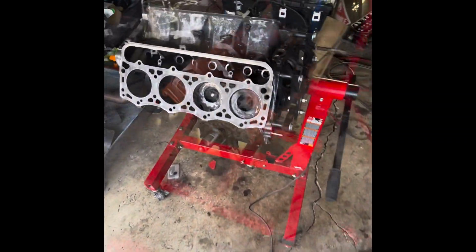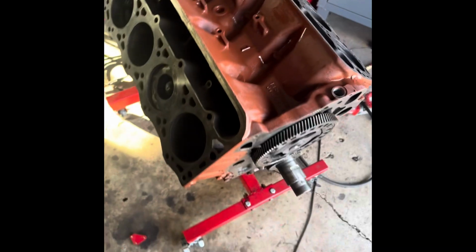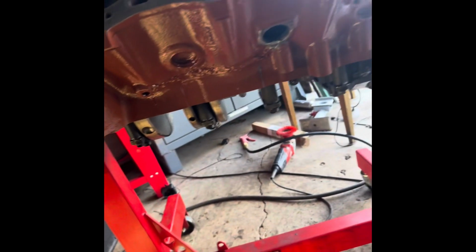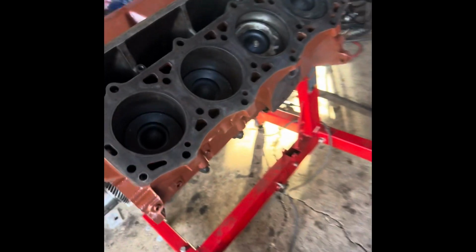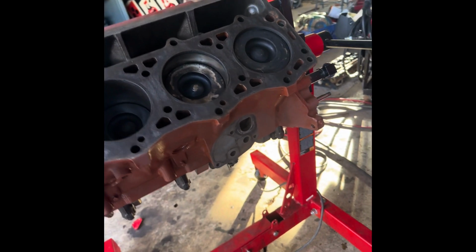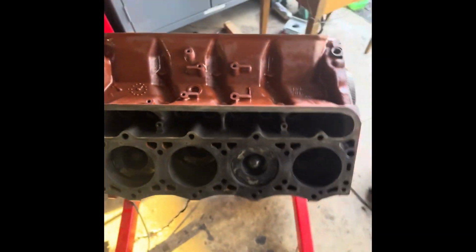So here comes the paint. All right. Turned out freaking awesome. So yeah, primer coat on. And then I got a little repair I got to do with some nickel 99 rods in a freeze plug hole from the weld. Found a blemish, so I'm gonna fix that up. And then hopefully tomorrow we'll get some paint on this thing. See you tomorrow.